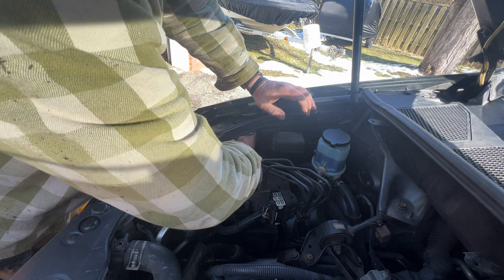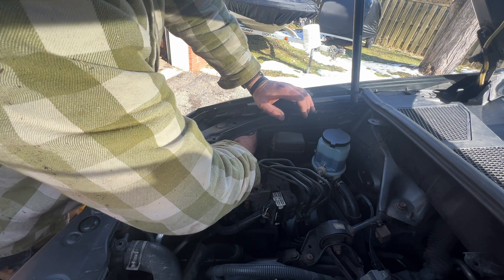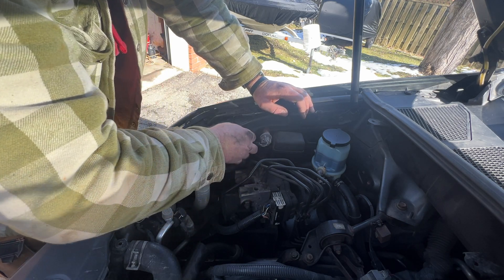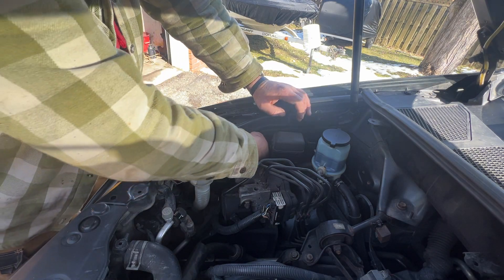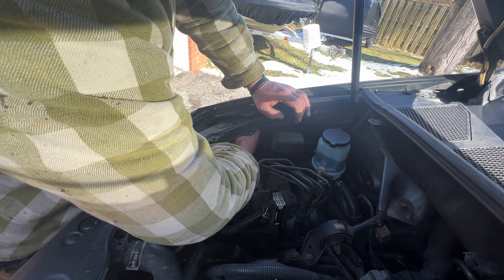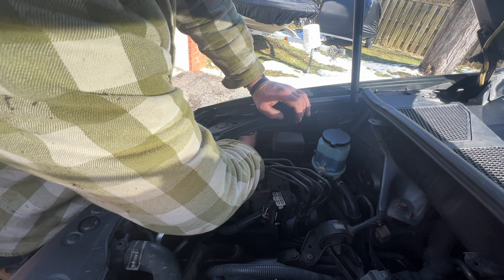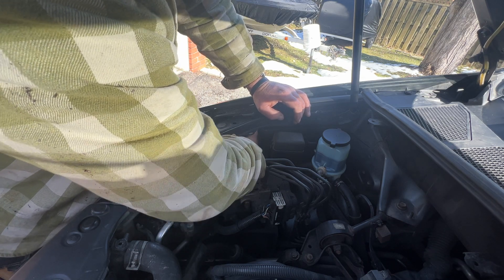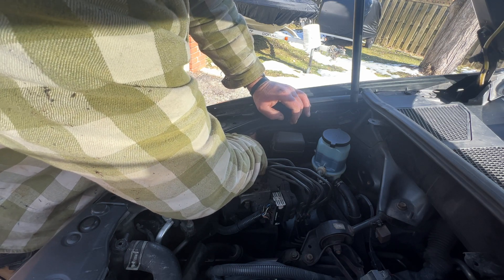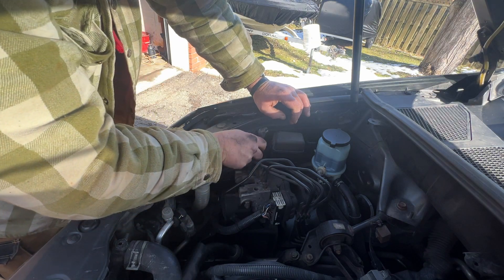I got to use the other hand. Counterclockwise and then pull it out. I know the bulb's not in here because I checked. Wrong one — that's the one below it, that's the turn signal bulb. You don't have feeling in your fingers sometimes, you grab the wrong thing. There it is — it's the furthest one away from you. Turn counterclockwise and pull it out with the wire.